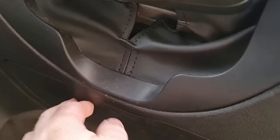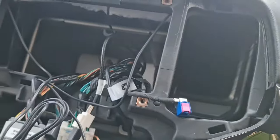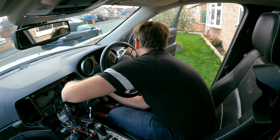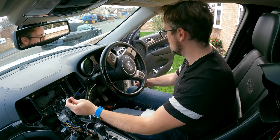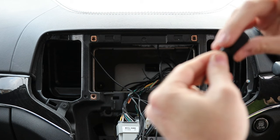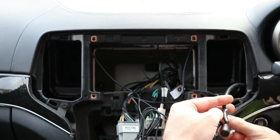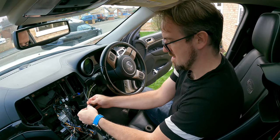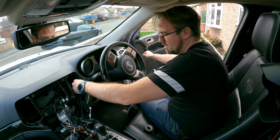I'm going to put my fingers in here and look for that cable as it gets threaded through — and there it comes. Now we're going to do it again but this time get the cable to come through into the main dashboard. Here's the wire coming through, so now I've got a wire that goes from here to here. I'm going to pop off the foam of the microphone and use some tape to tape it to the wire that I've got threaded through like so.